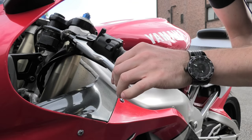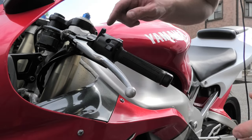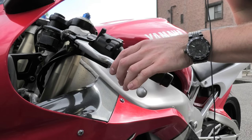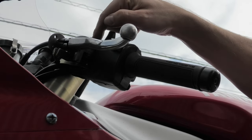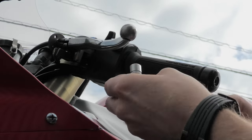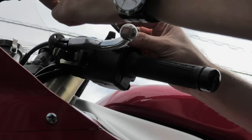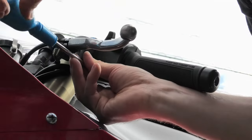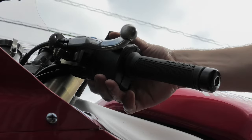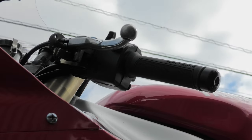On the other side, I've never done a cable clutch before so this is new for me. What gives me a bit of confidence is there's quite a bit of slack - some movement in there, which is what you need so you're not pulling on the clutch when riding. That tells me the cable isn't going to be impossible to fit onto the new lever. There's no slot on top, just a nut underneath, and even with this little bendy tool I can't quite get it on there, so I'm going to loosen this and see if I can twist it out of the way.